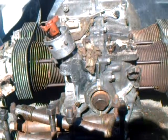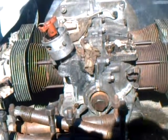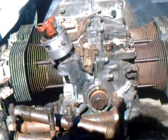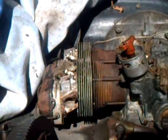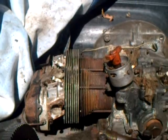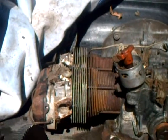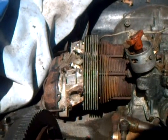When I took the frozen pistons out, it broke the skirts off on the bottom — they go inside the engine case itself, so I've got to get different jugs for that. The distributor was locked up; I got it freed up and cleaned up, and I'll put new points on there. Heads are good, but I've got to do a valve job.